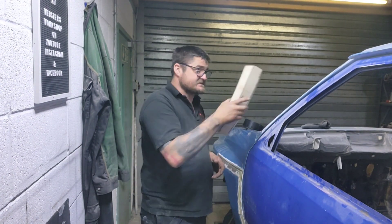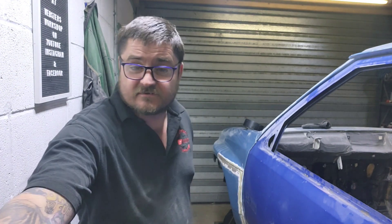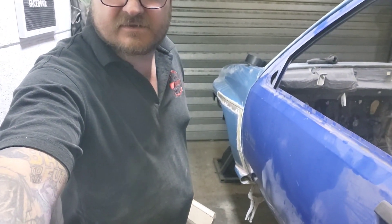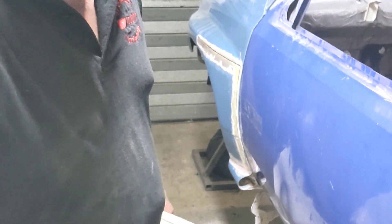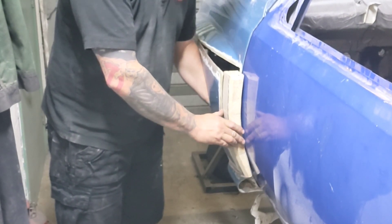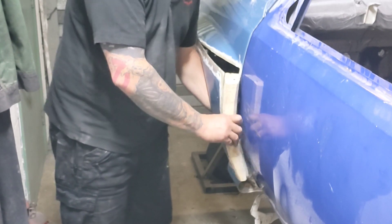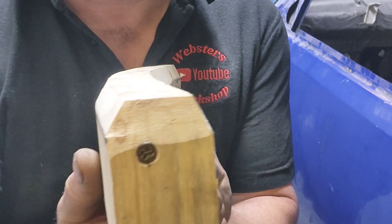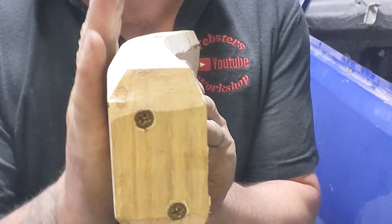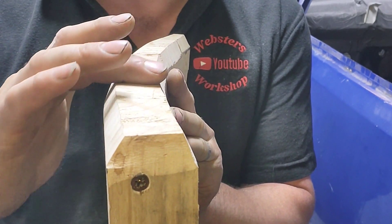We're quite squeezed for space down this side of the car. What I've done off camera - a bit of woodworking - I made a buck for the shape of the vent. The plan is we take the buck, pop it in at the right place where we want it. Once we get it right, we fiberglass all the inside. As you can see from the shape of the buck, that'll be the outside of the wing, that'll be the inside of the wing, with a slight chamfer on.